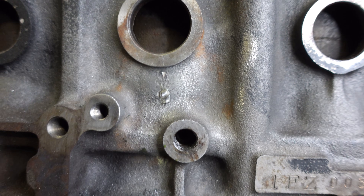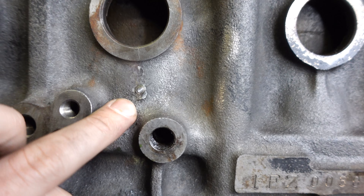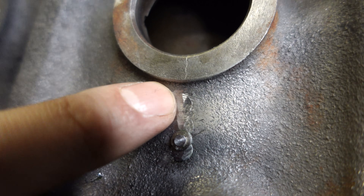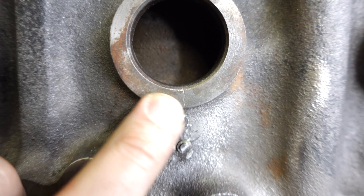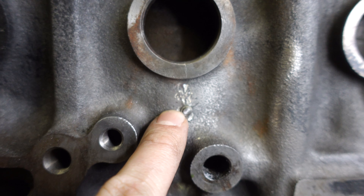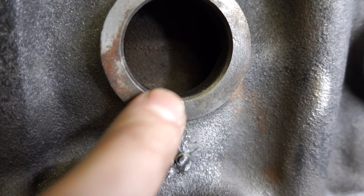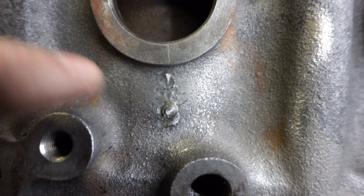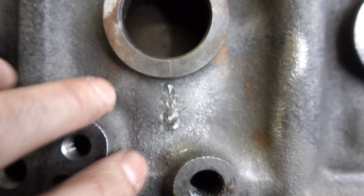We're starting to get a full crack repair here. I kind of strayed away from the directions — they want me to drill a hole in between and then space it out to the next hole. I don't plan on fixing the upper freeze plug bore because I don't have the right pins for it, and I honestly don't feel confident doing it. I think fixing this long crack is going to prevent a lot of the leak because it's going to prevent the metal from expanding apart, and it was leaking from that area in the first place. If I have any issues, maybe I'll use block seal. What I'm going to do now is manually make a hole in between this pin and that pin, grind it all smooth, and the repair should be done.